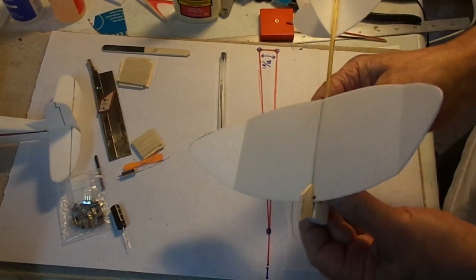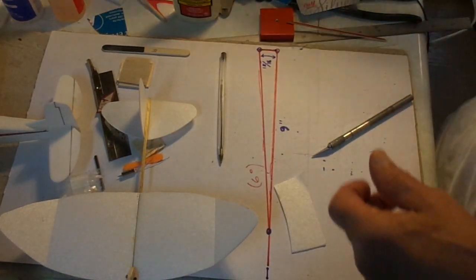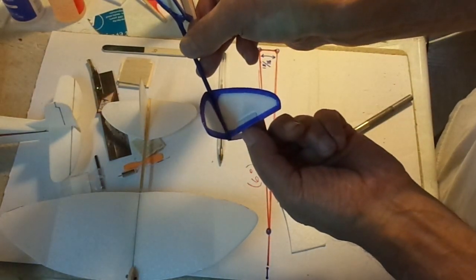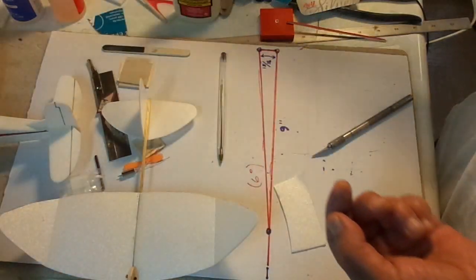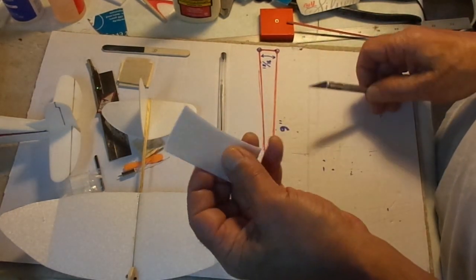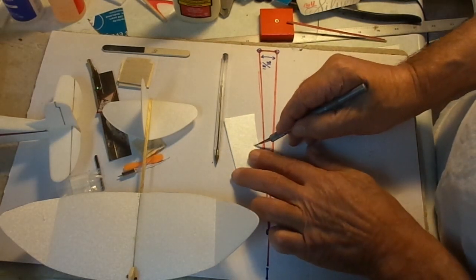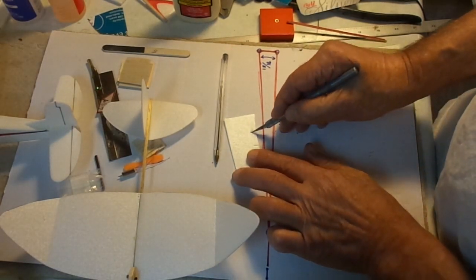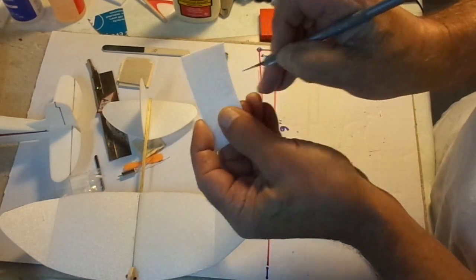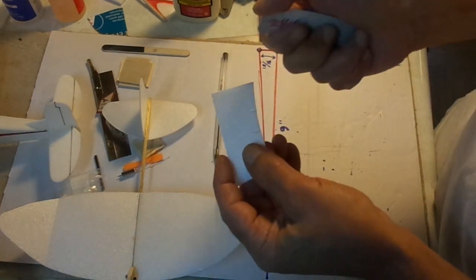Let's get right into it with a little side trip to make a trim tab. Now you can see we've got a little movable section of the rudder there to help us when we're doing our flight testing to put a little turn into it. Here I've got a scrap piece of material just like what our rudder is made out of. What we'll do is put two little slits in the trailing edge, and those are about perhaps a quarter inch in or 3/16,